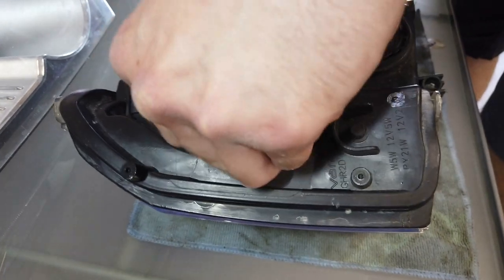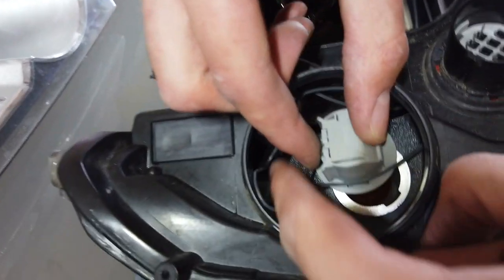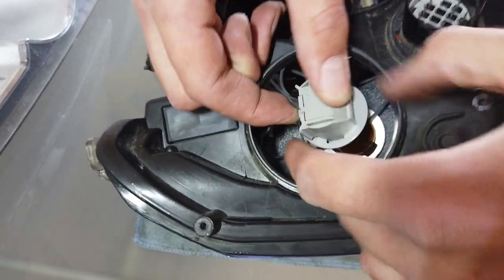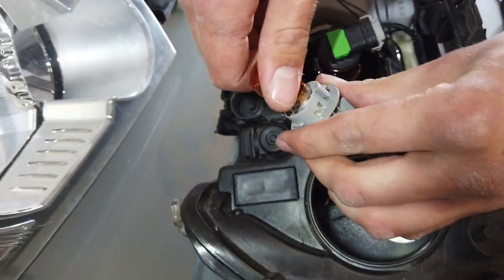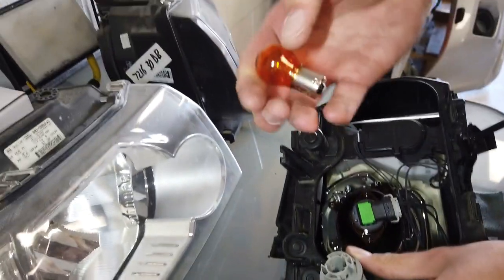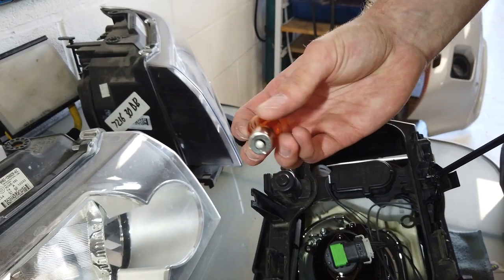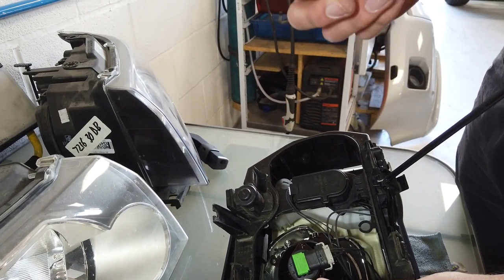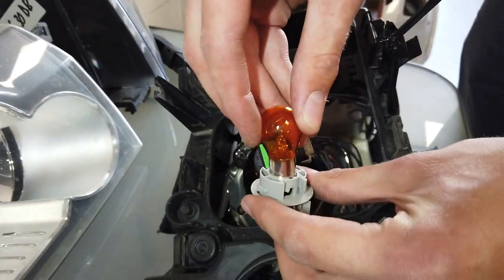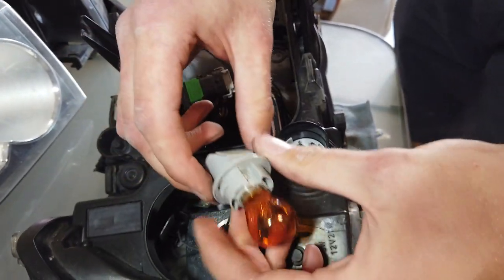It's out - and there's a wire, be careful. There you go - that's on a bayonet fitting so you just push and twist to remove the bulb. Indicator bulbs don't get hot enough to worry about - they have an easy life. So that's the indicator bulb removed.